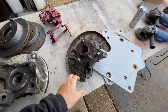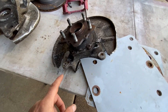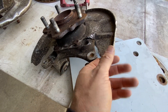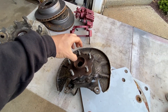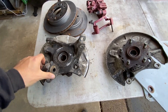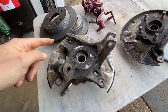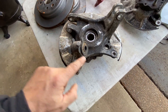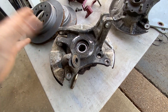I would love to remove these brake dust shields to give me better access but it's got four bolts holding it in. This section is actually attached to this section so I think you can only remove that if you remove the bearing and I don't have a press and I don't have new bearings and these bearings work nice. So I am just going to proceed with plan F. Cut this bit off, cut this here. I'm going to try and leave as much of the hub as possible. That needs to get flattened down - cut this off but I need to be careful when I'm cutting straight across there. Let's get on with that.